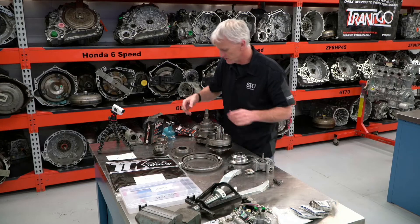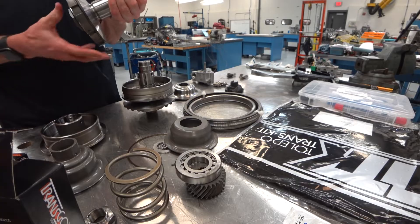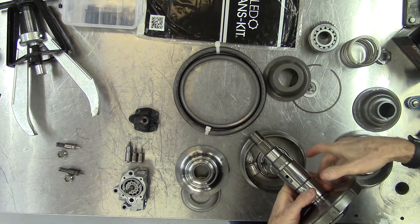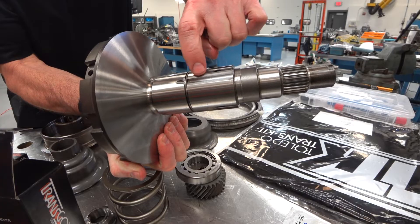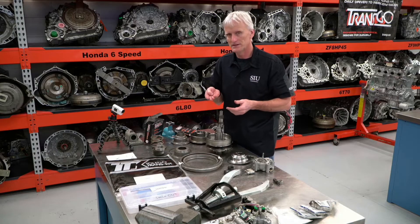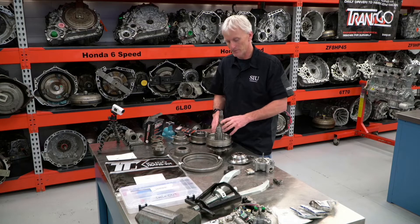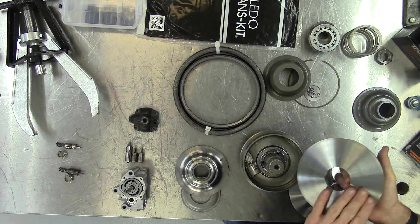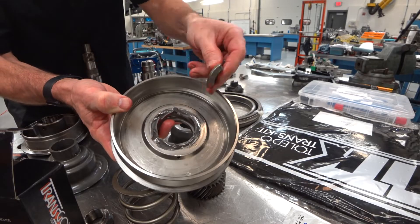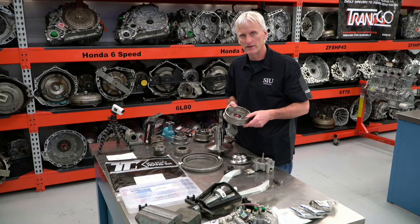Once you have it apart and disassembled, you'll notice that on these sheaves there are little ball-bearing grooves. These ball-bearing grooves need to be nice and smooth because that's what allows the pulley half to slide back and forth. Pay close attention to that ball-bearing groove and make sure there are no burrs. You're going to want to replace these ball-bearings — you wouldn't want to put the old ones back in. The ball-bearings take a lot of force; they're basically the only thing preventing the movable half of the pulley from breaking loose and spinning. As you can see on this piece here, we had catastrophic damage — it likely happened because the check balls broke, got caught in there, and things got jammed.